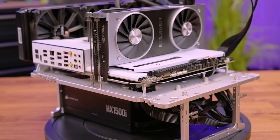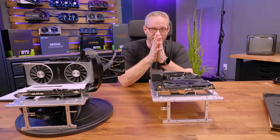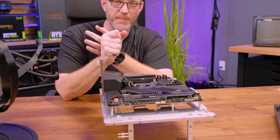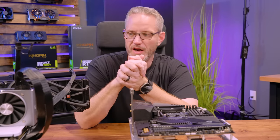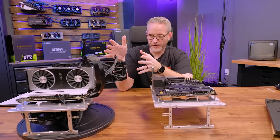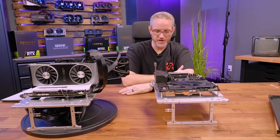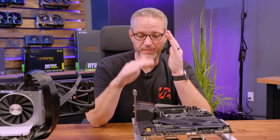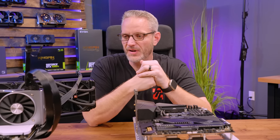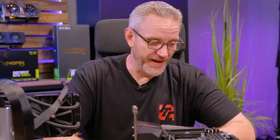I still need to get matching coolers and swap out the AIO. I did not go air cooler for one major reason: modern CPUs like the 13900K and 7950X use huge coolers that overhang the RAM, making it very annoying to swap RAM kits during testing. AIO is the way to go for test bench purposes, especially since I need to overclock the 12900K to close the deficit versus a 13900K for GPU testing. Anyway, I'll put a link to their website below - they did not sponsor this, I paid 100% retail. I'm happy I did. Thanks for watching, we'll see you in the next one.